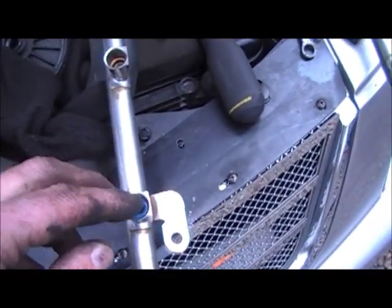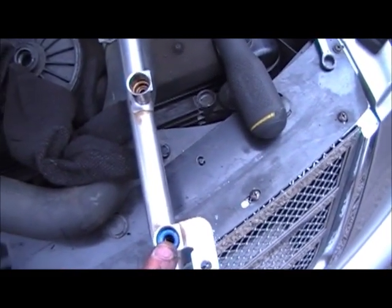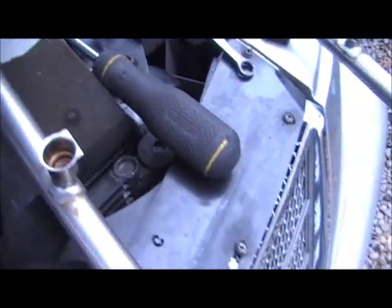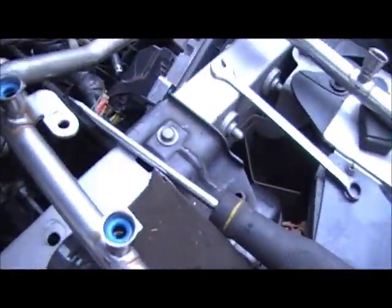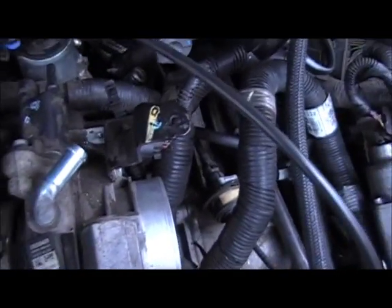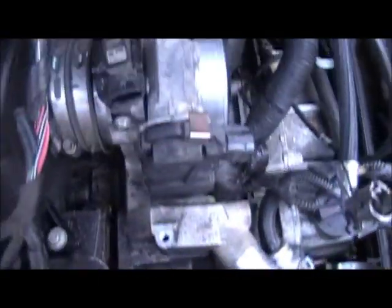All these little O-rings that remain in the tube, you'll want to take a pocket screwdriver, careful not to damage the O-ring, pop it out, put it back up on top, the top ring of the injector. See, this one stayed. It's missing. But take out the other ones and put them onto the injector, because that way you can put them back on. They go into a little groove right there, and sometimes when you pull them out, they just pop off the injector instead of the tube. So you want to put those back. While doing that, it separated itself from the block from me wrestling it around. So looks like I'm ready to try and pull this out the hole. If I have any problems, I'll let you know.